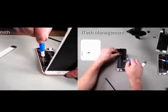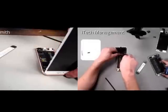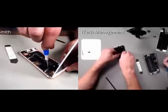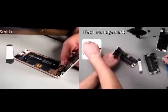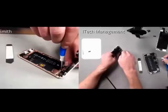which gave you that feel of vibration. So, Ed, I'm going to remove the, it looks like there's 4 screws holding down my shield. And did you say there was 5 on yours? Yeah, there's 5 on the Plus. Which, personally, I prefer 4 screws over 5 for those that have taken apart an iPhone 6. And that middle screw is always one of the hardest ones to get, in my opinion. But also, there's one non-magnetic screw, and we magnetize our tools before we use it.